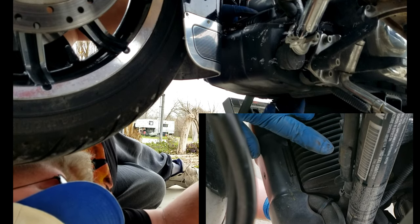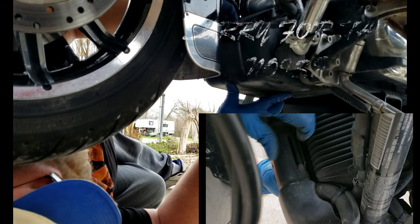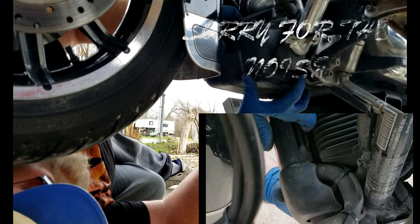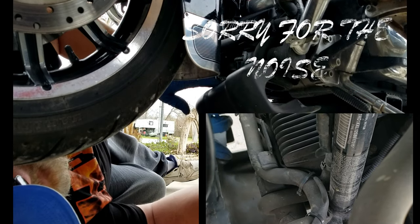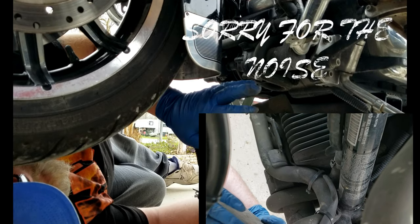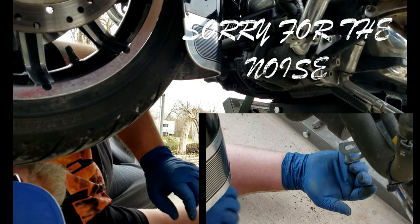What we're going to do here is get this cover off the cooling pump. There's a little tab on here — you give it a pull, and once that comes loose, it's got two little pop tabs like your side covers. You just pull forward on both sides and your cover comes off. You can see the little tabs right here and here. Cover comes off real easy.